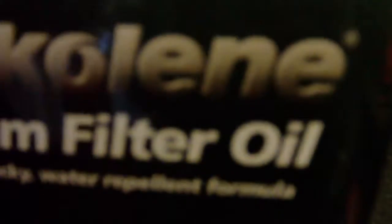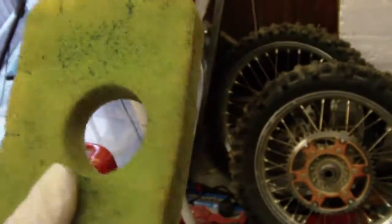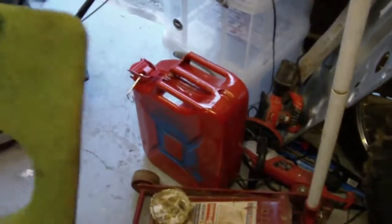My top tip: just use a bit of oil on the Briggs and Stratton foam air filter — it makes it go green. I've cleaned it already, and it goes a little bit blue and it's tacky. That tackiness holds all the gunk in the foam. You can see when it fills up like that.